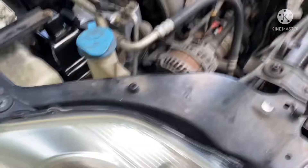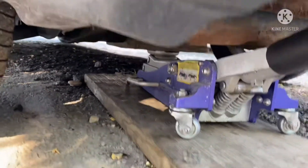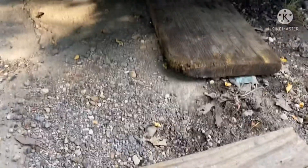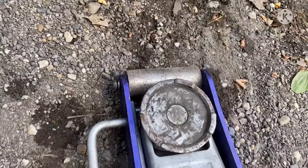That's the negative ground — don't forget to put it back. So now I am going to take my jack out. See the mark right here? That's where the oil pan got stuck in it. But if I put it straight right there, I mess up my oil pan, because it's metal to metal.